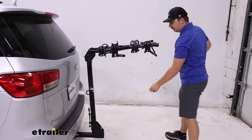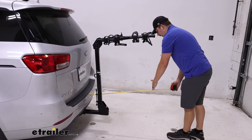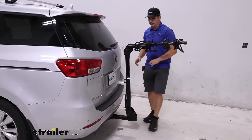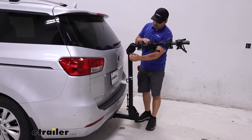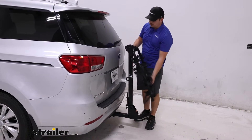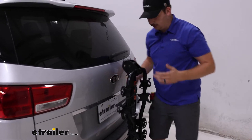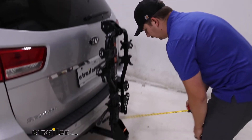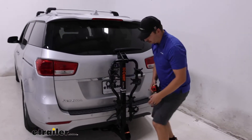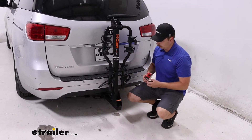From here I'm going to get some measurements. We'll see how far it sticks out from the back bumper — it's going to add about 34 inches, and again with the five bike version it will stick out a little bit further. On both versions when you have bikes unloaded and want to leave it in your hitch, just remove the pin and retaining clip from up top, fold the arms down, and re-insert it with the newly aligned holes. Now the bike rack will only be sticking out about ten and a quarter inches, so it's a lot more manageable and condensed and it's ready to go for whenever we want to ride next.